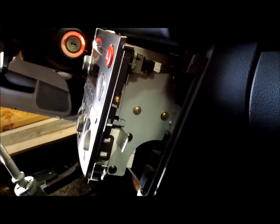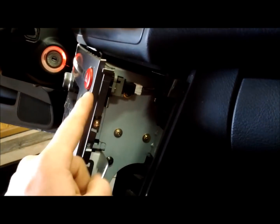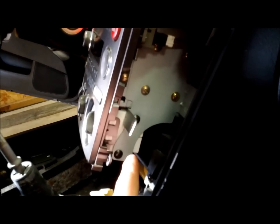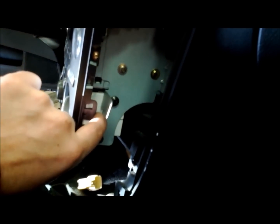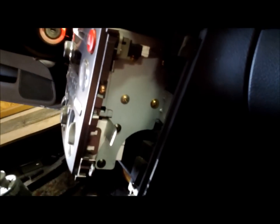We're going to slide the passenger side out first. We're going to disconnect this little push clip here to disconnect the hazard button. Next we'll take these two black screws out — that'll allow the climate control part to stay in the car. We'll do the same on the other side, removing those two black screws. Then we're going to push that out by pulling these little black tabs, pushing in the control with our thumb, and it should slide back into the car.